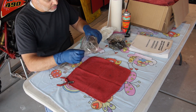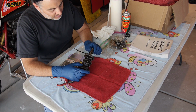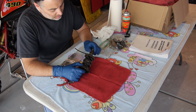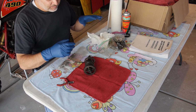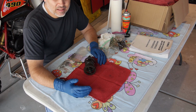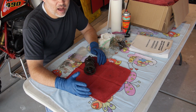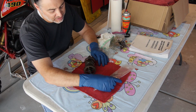Kalani, when I was taking his motor apart, we literally could not get the sprocket off. I can't remember what kind of problem he had, but long story made short, the splines were a little buggered. When you've got your motor split apart and you're doing all this work anyway, and you can't get the sprocket off, or it's spinning and doesn't fit right, you'd just be pissed off that you didn't replace the main shaft while you were in there. So, we are replacing the main shaft.